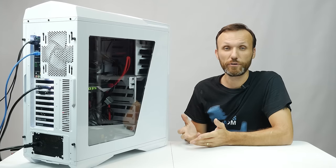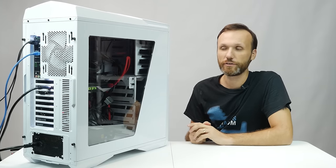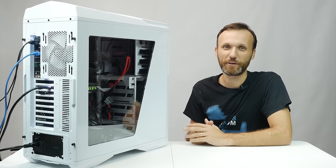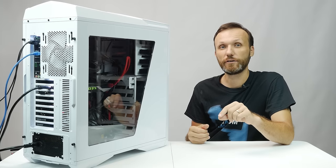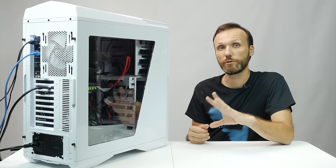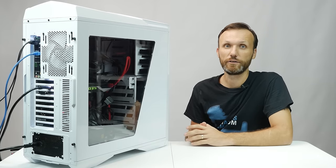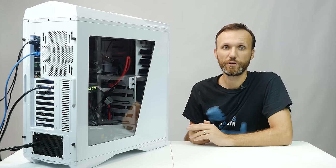You can buy Windows on Amazon, and they'll send you a USB or a DVD drive, or if you don't want to spend any money, you can actually install Windows for free in a totally legal way, which is something I didn't even know myself. Basically, you'll go to the official page where you download Windows, and they have the media creation tool. You download that tool, install it, and from there it will ask you what version of Windows you want. I would select the 64-bit version, and you can select the Home or Pro edition. With that, you can create a bootable USB drive.